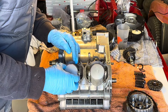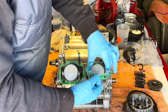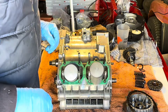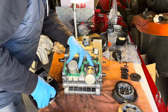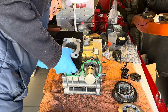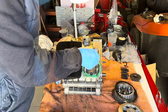Well, that was an almighty struggle — just less practice really doing it. So anyway, it's done. Let's try and get these base gaskets on. Okay, pistons are on the right way round — arrow pointing to the exhaust pipe, little holes at the back for the fuel to come in. I've put the piston at the bottom of the stroke, just need to check the position of the pins. Same the other side, but now this is in the way to make life just a bit more interesting.